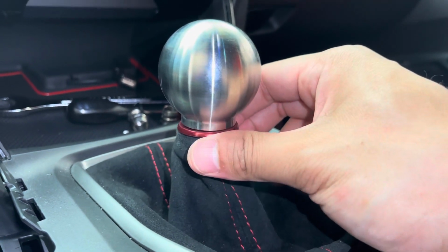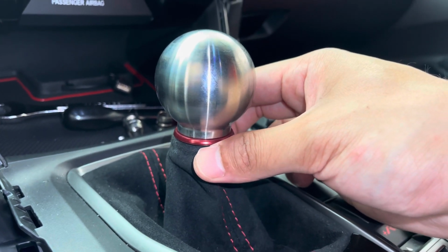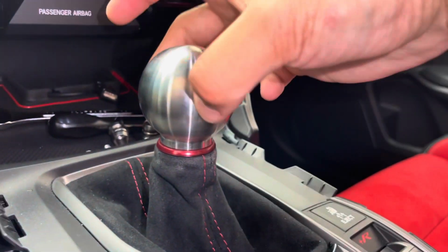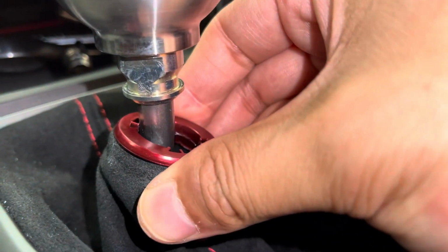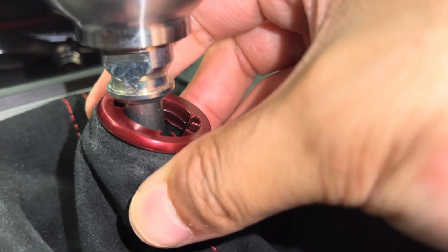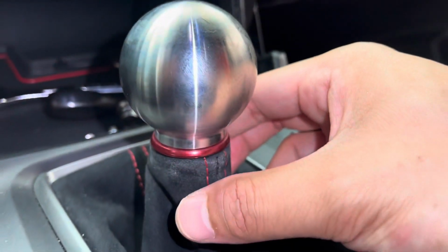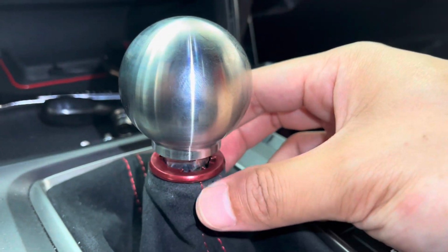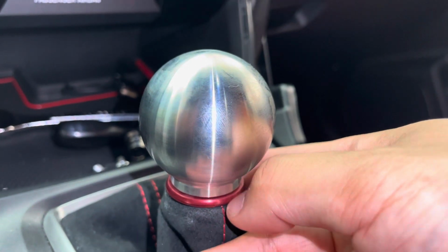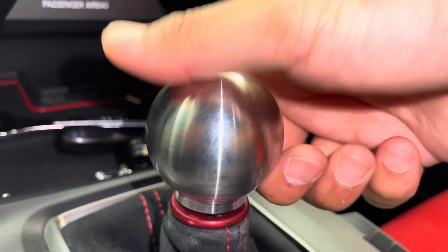You can see right there. Basically what happened was when I was trying to pull this down, it was such a pain that I actually put a pry tool on the left and right side when I should have been putting it here, only in the middle, because basically you have clips in there, and you can see right there I cracked it, so it's not hooking anymore. The left side's still good, but the right side broke. You can see right there. So to any 2020 or 2021 owners out there, if you pry this off, like pulling down with a pry tool, put it in the middle part so you don't break anything off, and put one here in the front and one in the back.